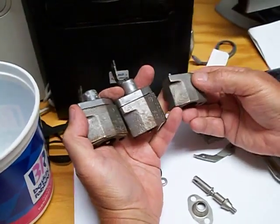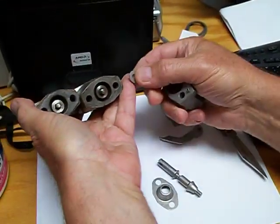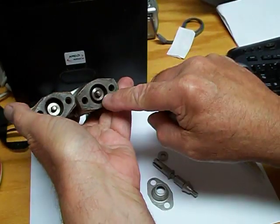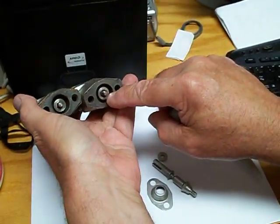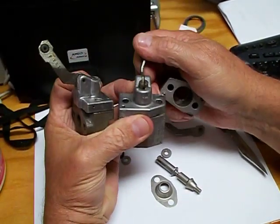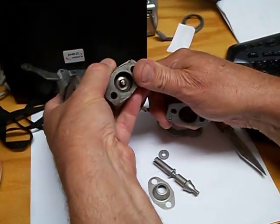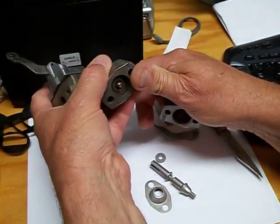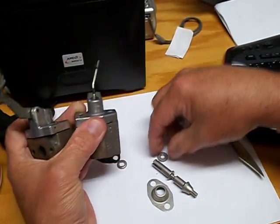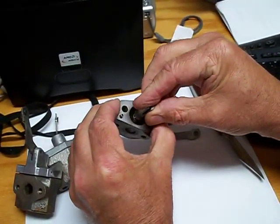You can see here how this piece is here with the nut around it. The nut's eroded away by the exhaust gases — that's all that's left of it — and then the mechanism inside, so that when you pull it like this, it moves that seat and closes it at wide open throttle, and at idle the spring pushes down and closes it.